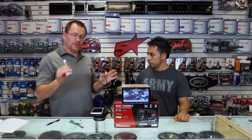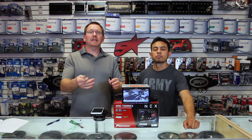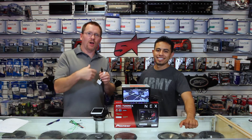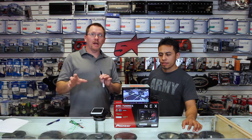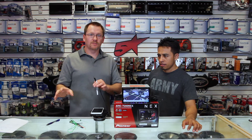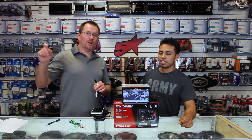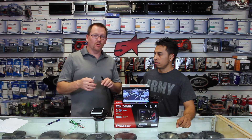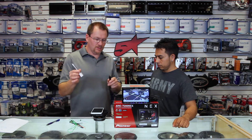Quick troubleshooting tip: if for some reason you can't get this to work in your car, get out of your car, walk into your house with your cables or your dongle if you're doing the MiraCasting, and plug it into the HDMI input on your TV set. Try to get it to work there first, so you're not scratching up the interior of your car or banging your head against the wall. If you can't get it to work on the TV in your living room, it's not the car's fault — you've got a bad cable or you haven't paired it properly. Troubleshooting tip 101.